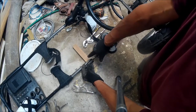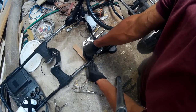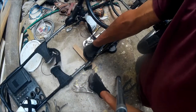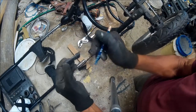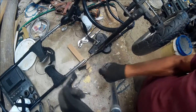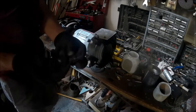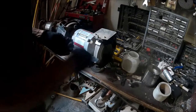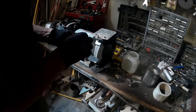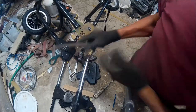These are the two little plastic pieces I talked about. Because I've got this scab piece of metal over top, the diameter has changed, so I'm going to have to take that plastic piece and grind it down to compensate for the additional thickness of that additional piece of metal. It's about an eighth of an inch thick, so we're going to have to grind off about an eighth of an inch off of this plastic insert. I've marked it, I go to the grinder — you could use whatever, but since my grinder's here it's pretty quick. I've got pretty good control over the depth going into the plastic, making sure I'm not going too deep.